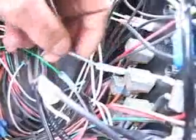On the back of the warning light switch was a gray wire, number 115. We determined that this carries the signal for the interior lights. So we cut this wire and we install the gray wire from the child reminder back towards the warning light, or towards the interior light switch. The green wire from the child reminder gets connected to the other end of the wire, which heads off towards the interior lights.